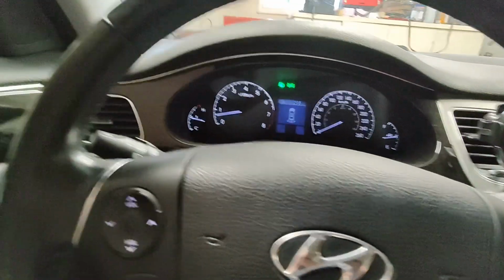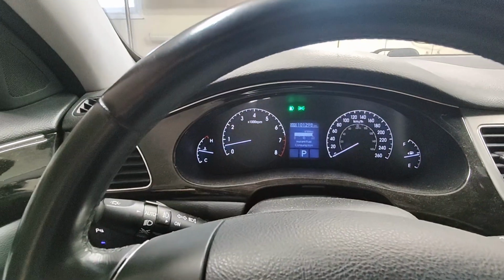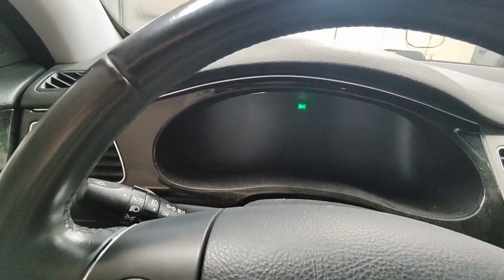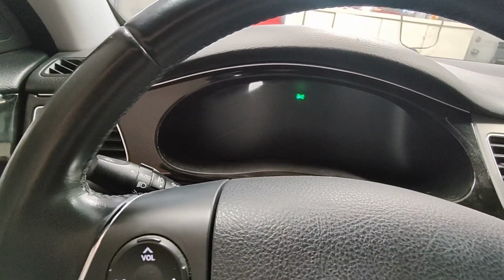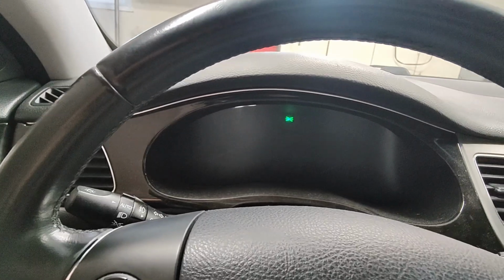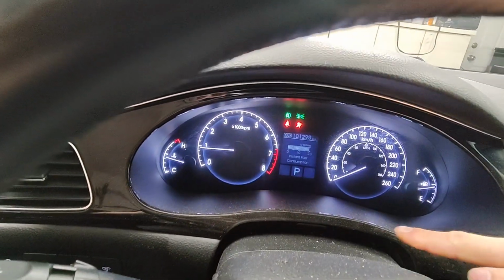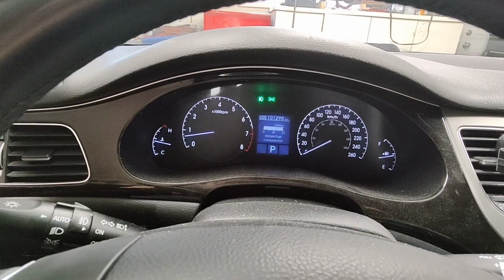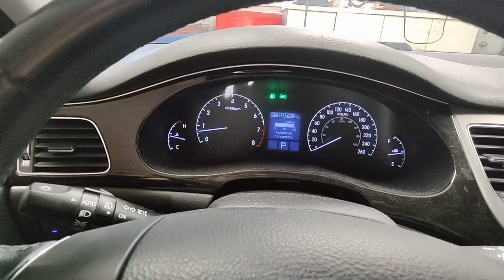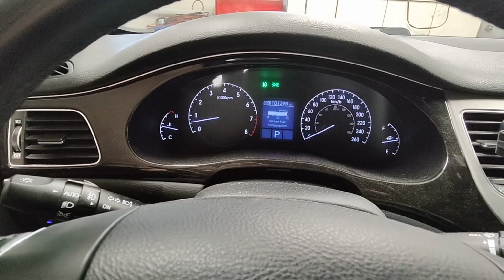Yeah, usually when that happens, you don't get a check engine light or any codes, but we're going to scan it and see what kind of codes we have anyways. I'm pretty sure there were no codes. So yeah, I pulled into the garage earlier, and then it stalled. And when I tried to crank it all over again to get it started, it cranked for a really long time. And then it did fire up, but there was no RPM on the tach. And then that ESC light was on solid. But yeah, I'll go grab the scanner and see what kind of codes are in it. I'm pretty sure there are no codes for any kind of crank sensor or under the engine module. So yeah, let me go grab the scanner.